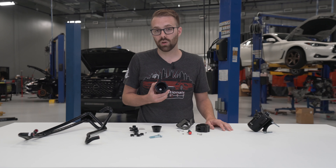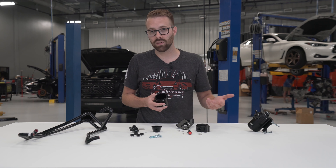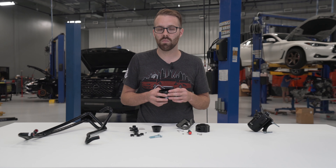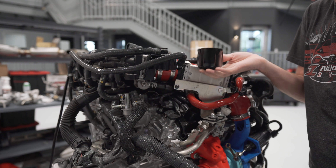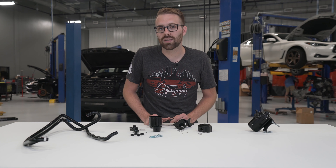Now that you've got the kit installed, really not a whole lot to do — you just need to make sure you drain it often enough so it doesn't overflow. This is a fairly large capacity and you're probably not going to fill it more than once every two or three oil changes on most engines. We recommend checking it every 500 miles until you get an idea of how quickly it fills up, and then most people drain it with every oil change. To drain it, the three screws come out, you stick your hand under it, let it drop, dump it out, and put it back together. That wraps up this episode of Behind the Design — please like, subscribe, and comment with what products you'd like to see next.